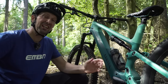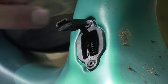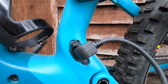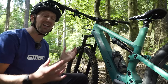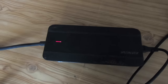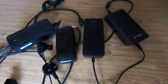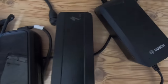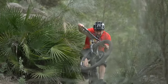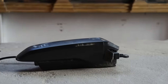So how do you charge your e-bike battery? A lot of manufacturers have a charge port on the frame — similar to your mobile phone, you simply connect the charger and it charges the battery. Some manufacturers allow you to remove the battery from the frame, meaning you only have to take the battery inside. Brands such as Bosch have a fast charger that can charge a 500 watt-hour battery from flat in around three hours, and even to 50% in just one hour — perfect for mid-ride lunch breaks. For general chargers and batteries of around 500 to 700 watt-hours, it will take around four to six hours for a full charge.